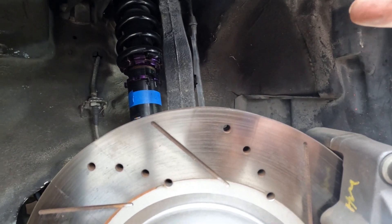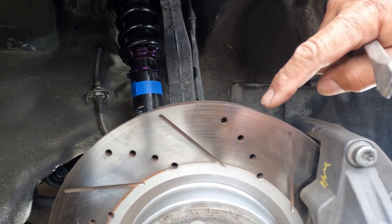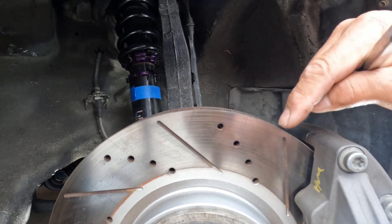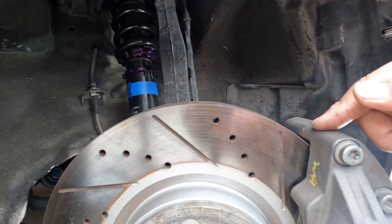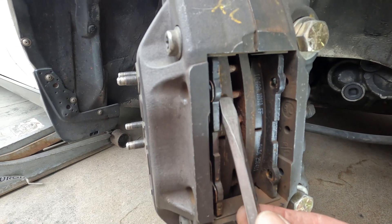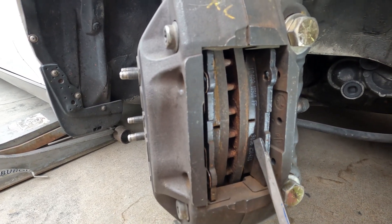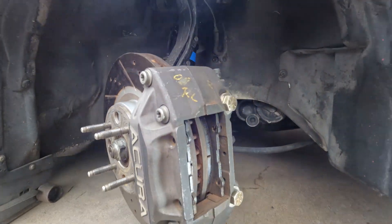It's better to have the brake pads go farther down rather than have the brake pads higher than the rotors. If the brake pads are higher than the rotors, there's a possibility of squeaking and noise. What I did on this one is I made it flush — even right there. You can see this one side is a little bit farther down. I'm gonna remove this, let me show you.